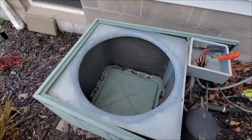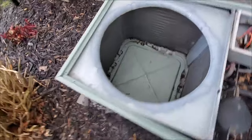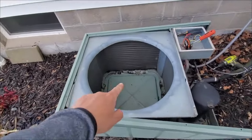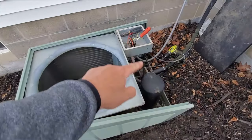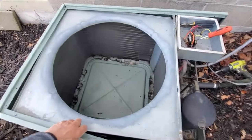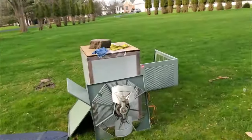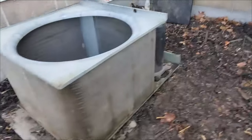That's a little more acceptable — not perfect, but once I'm done I'll spray that out and get the last remaining dirt. Now it's time to remove the outside housing. Starting from this panel, pull that way since there's nothing on this side to stop it other than the two front screws — make sure those are removed or it won't come off. And wow, there it is — totally naked. That's the housing right off, and now we just need to clean these fins all the way around.